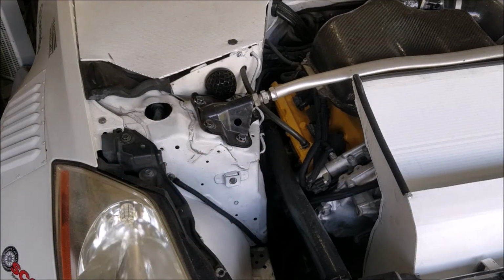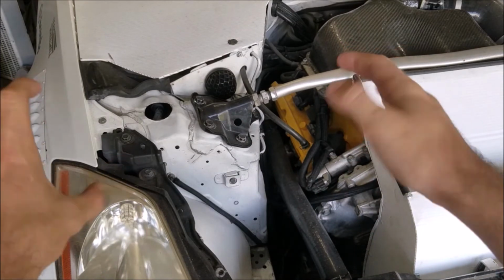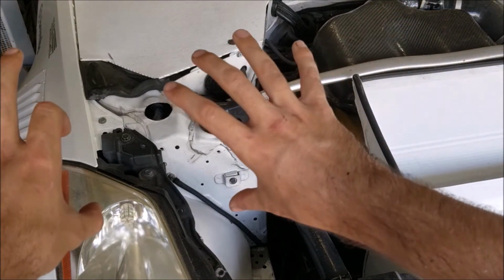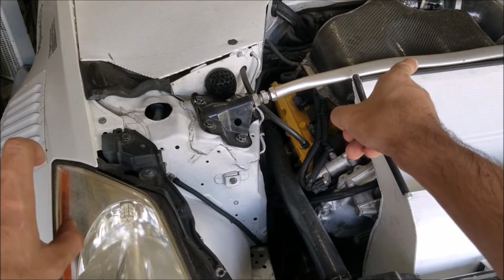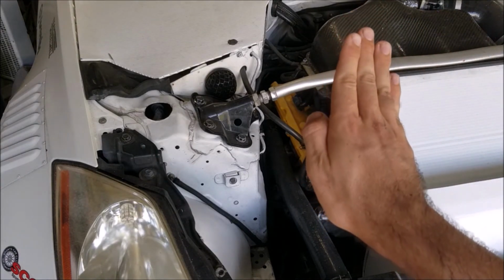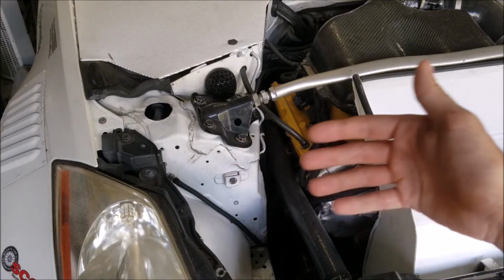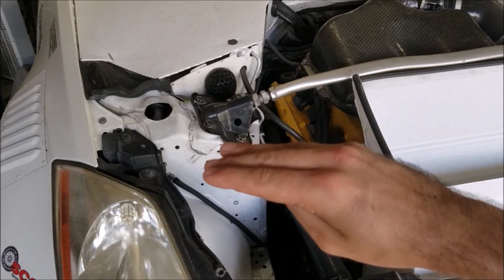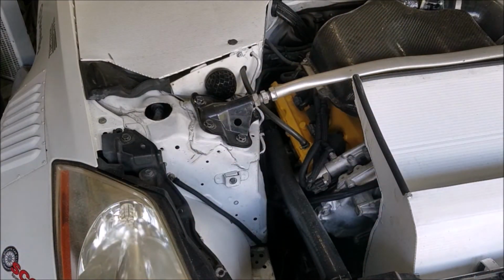So what you're going to have to do is take your power steering rack out. There's a very large collar on either side, but you're going to back out and you can slide the whole rack out once you remove the pinion out of the driver's side. You'll see that sticking out. That's what directly connects to your steering column. Once you have the pinion out and that nut out of the way, you can slide everything out. You'll see that disc. He's got a great picture of it. You just have to simply cut it on one side and you can just pop it right off. It comes off pretty easily.